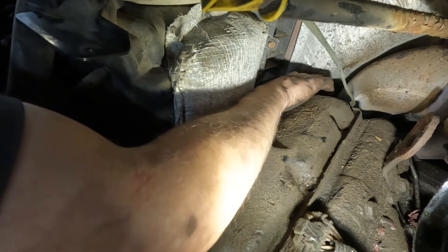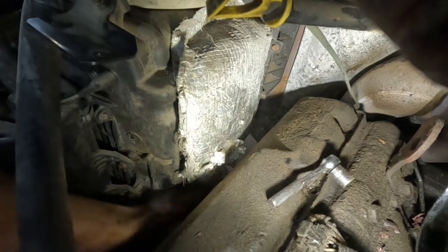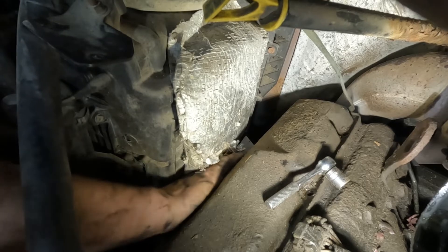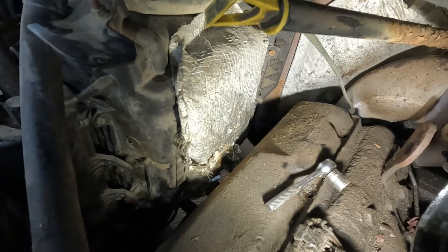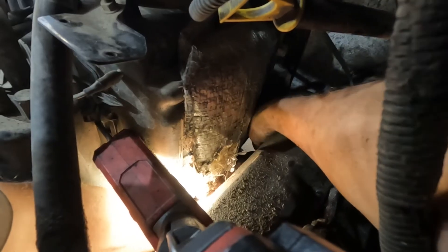This one you can drop if you're not careful. These two that are close to the air intake — well, that's the cab air intake — you need to get those with a quarter-inch ratchet. On my other truck, the Excursion, you couldn't even get a ratchet in there; we had to take the shroud out and use a combination wrench to get it from below. Just a small difference in engine positioning on that truck, but something to be aware of. I'm using two hands to spin that out with one finger on each side and pull out the bolt, because they're very hard to spin with just one hand — you have to put counter pressure on it.